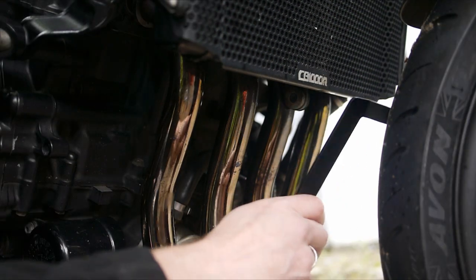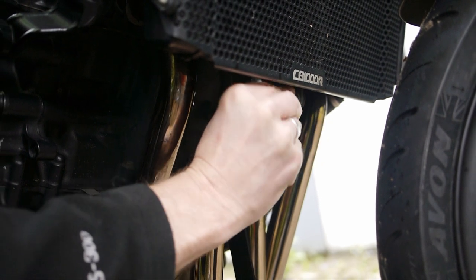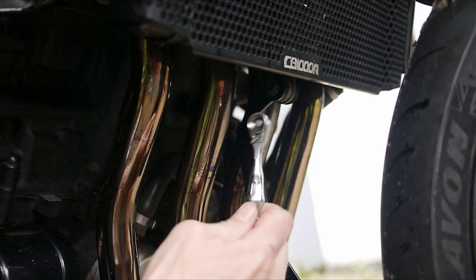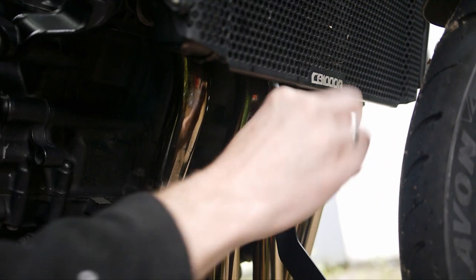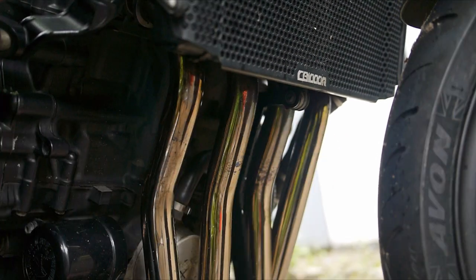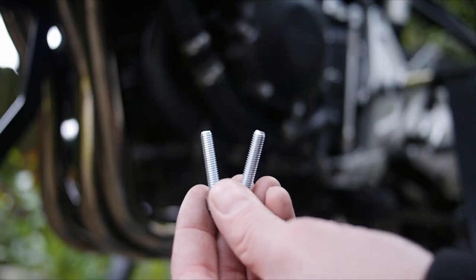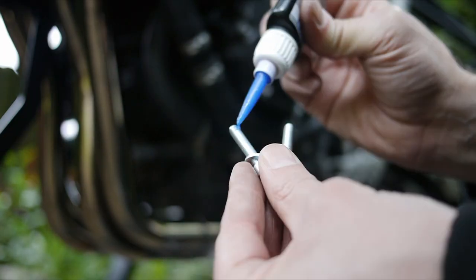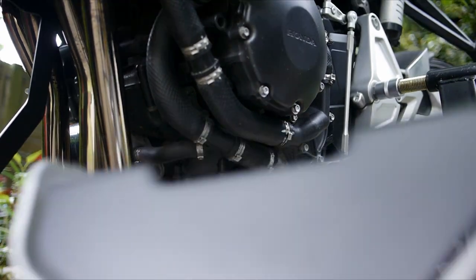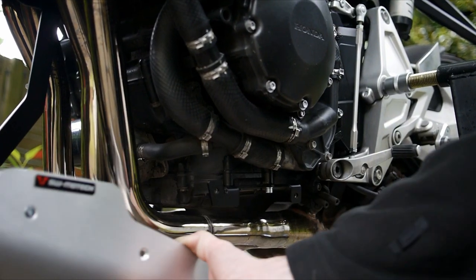That original bolt can go - I'll replace it with something better if I ever need to in the future. And then this long piece of bracketry comes into action. Put some threadlock on the bolt, around the back like that. The bolt from the SW-Motec kit then goes in there and takes the place of the toffee Honda one, which I shall ratchet into place with my also beloved Wera Toolcheck Plus Cyclops Ratchet. I am turning into such a massive Wera fanboy - or Wera as they should be called, because it's a good proud German company. Leave that loose for positioning, because that then provides the foremost mounting point for the belly pan. Come round to the other side - two bolts, two washers, dollop of threadlock, the powder-coated steel bracket for this side. And now it can present the belly pan up to the bike.